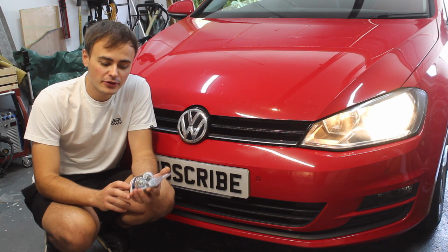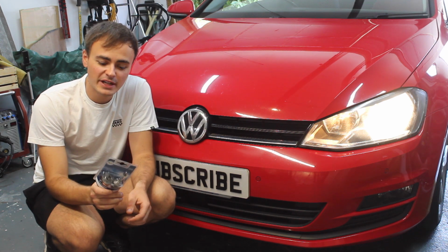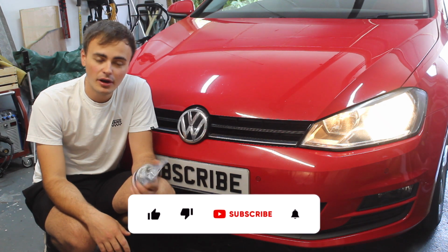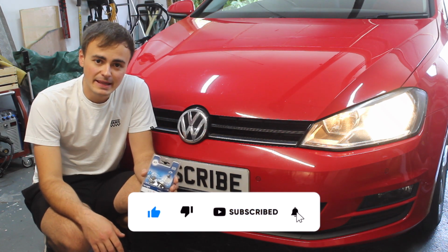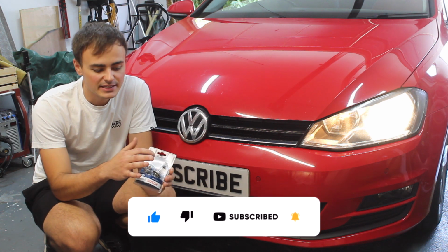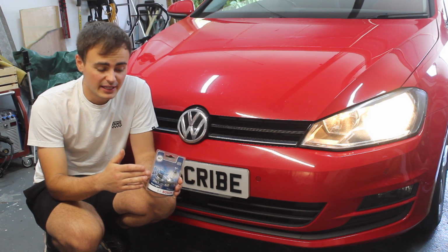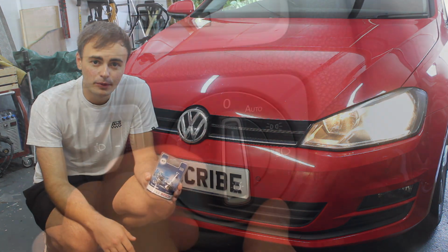This week I'm going to be showing you how to replace the headlight bulbs on the MK7 Golf, but this process will be the same for many different models of car, so hopefully you'll find this video useful. And I'm going to be replacing the dipped beam headlight bulb. It takes an H7 bulb, and I'll be talking a little bit about the different bulbs you can get and do's and don'ts when replacing your headlight bulb.